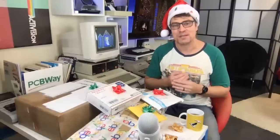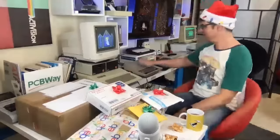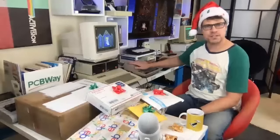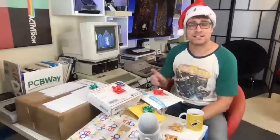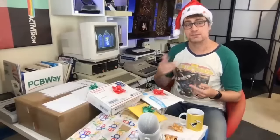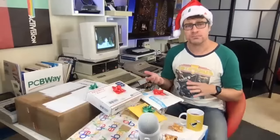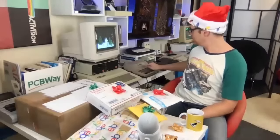Let's get unwrapping. I was overcome with emotion at the feedback of the Atari painting video. The emulsion painting is looking great with that lovely paint job that doesn't rub off. I still feel like it's a little better for this use case than Retro Brighting — just giving it that light dusting of spray. Retro Brighting can come back; the yellowing comes back after a couple of years, sometimes months. You have to repeat the process, dismantle everything, add bleach which can make the plastic more brittle. This took literally 60 seconds of actual spraying, and the yellowing is not going to come back.